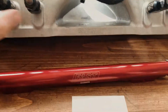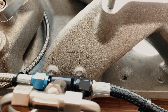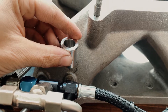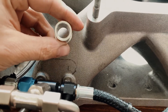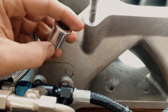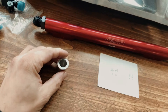I'm going to go ahead and get the height set for these and then drill a single pilot hole and see how well I can get the holes set in there by hand. It's a fairly large hole and it's going to have to be at an angle. I'm definitely going to take my time. This stuff is pretty thick — about an eighth of an inch — so there's definitely some meat there to weld to if there's any sort of issue.